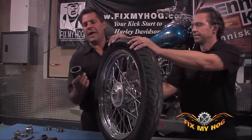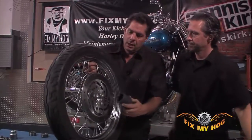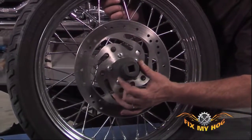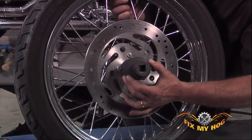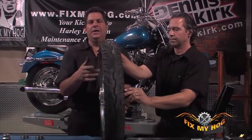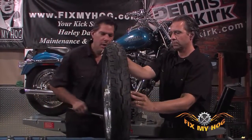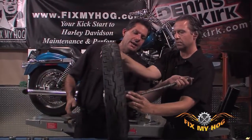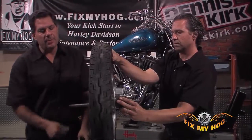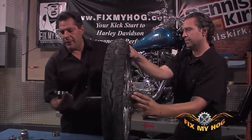I'll use a large diameter socket. This socket will fit over the hub, but yet land between the rotor hardware. Again, you need two sets of hands. You need to work with a partner. I can send a threaded rod with a nut on one end completely through the hub. I can then put one of the new bearings on.